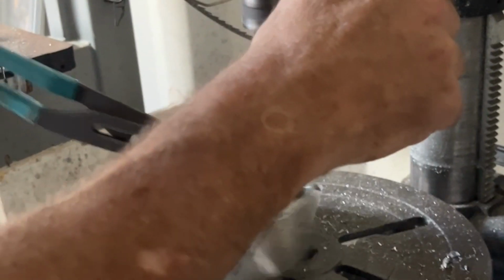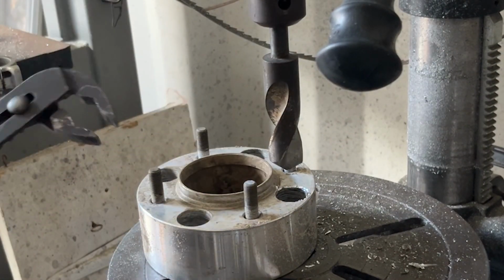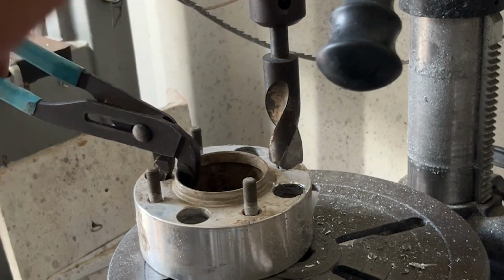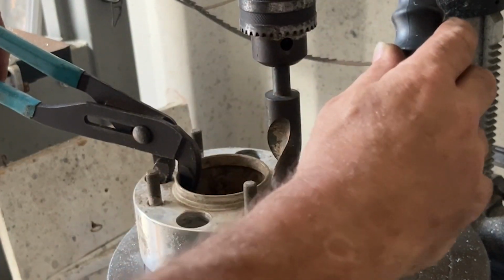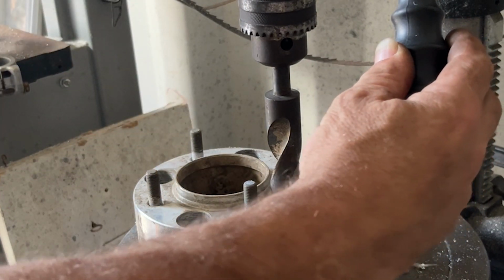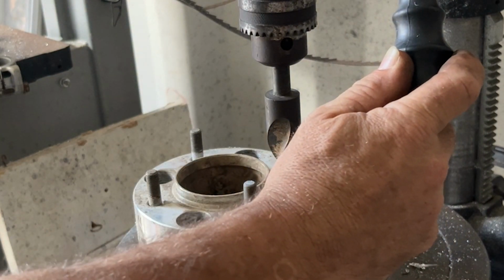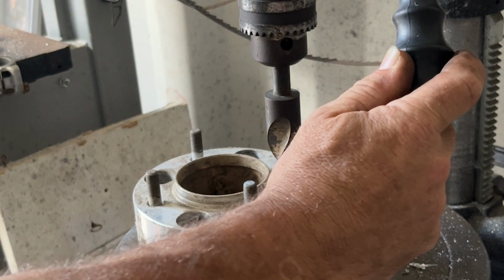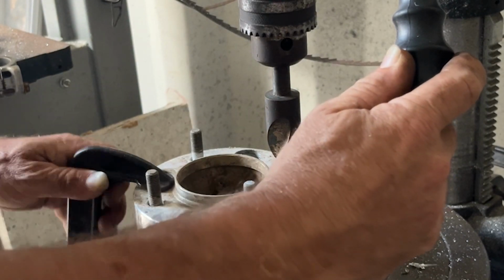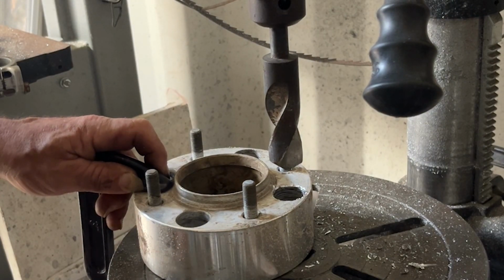What we're doing here, these spacers, you can barely fit a skinny chrome 17 millimeter in there to get those lug nuts out. So I got a 1-inch drill bit. We're going to make the holes bigger. A little bit easier to get stuff off. Maybe we'll stop stripping lug nuts because we can't get in there all the way. Yeah, probably should have some 14 millimeter lug nuts on there, but we've got 17s floating all around the shop. These things all come with 17s.